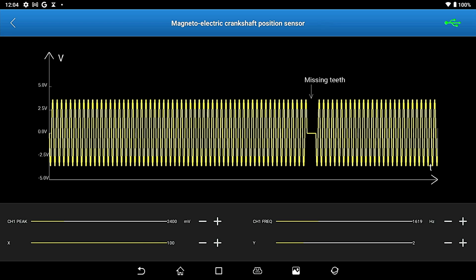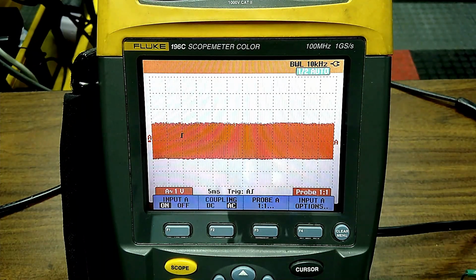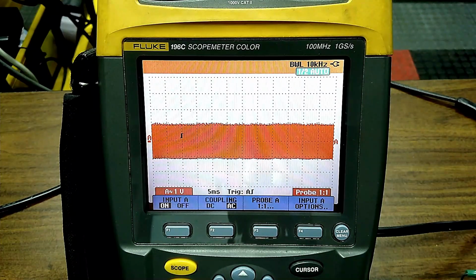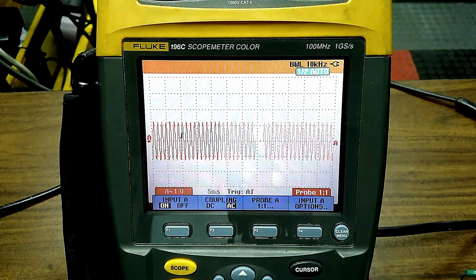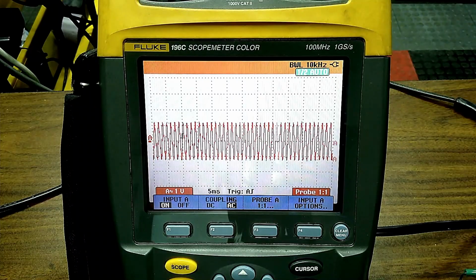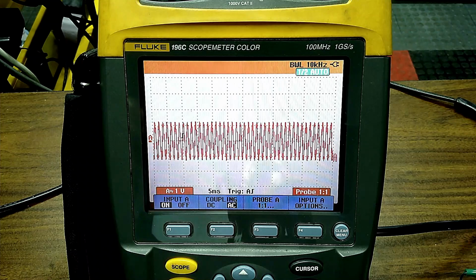And we could also change frequency. Go back to the scope. You see the difference in that frequency? You've got a picket fence. If we had a hole in the fence, if we have a dropout, this is easier to see. This is called the signature of the signal. And you can see where number one is. You can see it come up right over there, right?